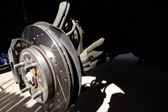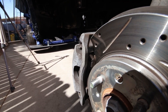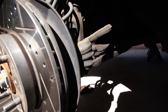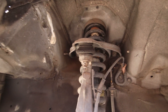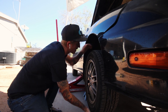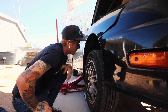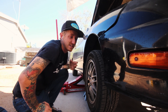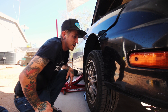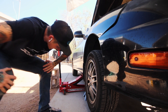I'm going to do a quick visual inspection since this is going to be a long road trip — he's taking it to Wisconsin. Brakes look new, pads have basically all the life left. The tie rod boot is very dried out and looks a little cracked. Same thing with the upper control arm — it looks pretty worn. I'd personally replace those; they're cheap. Get the car aligned before you go, peace of mind. The ball joint looks pretty well dry and cracked — the boot is very dry so most of the grease is probably dried up.